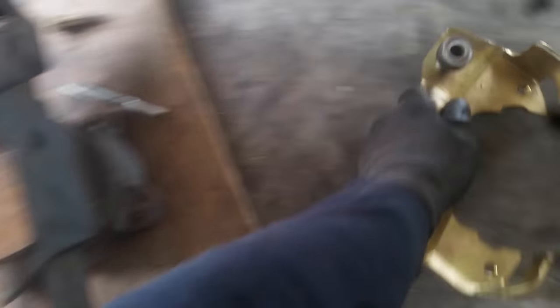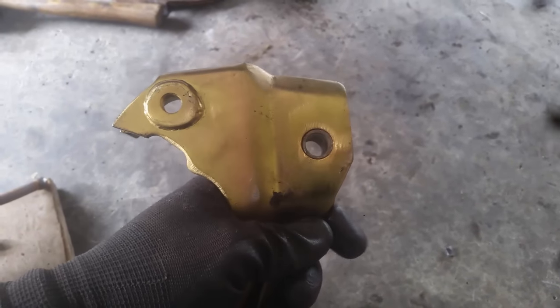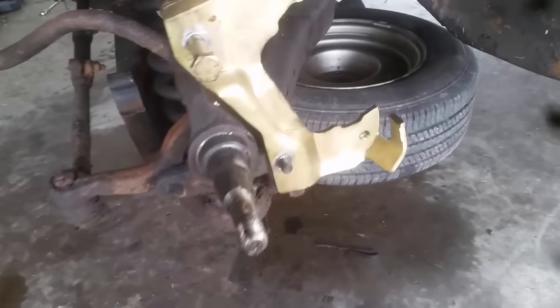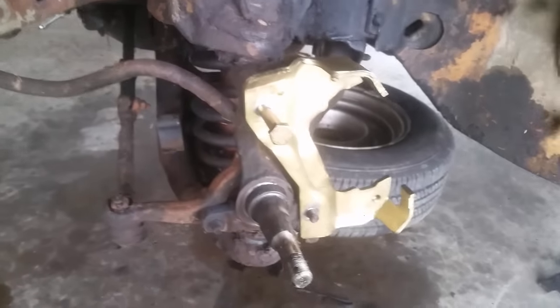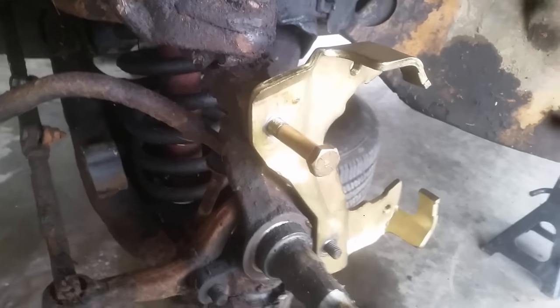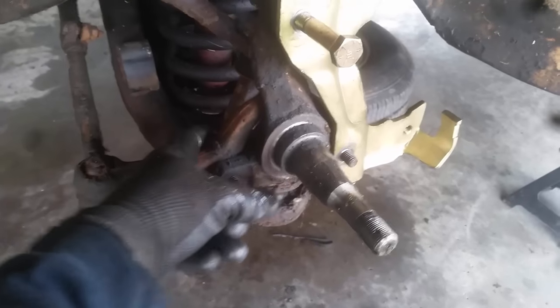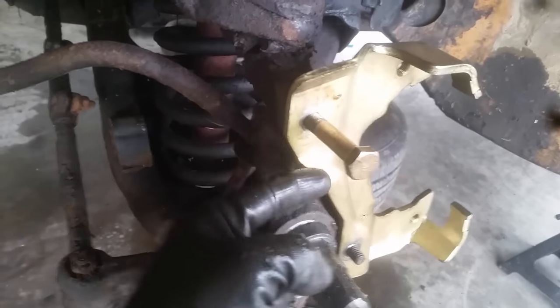It kind of goes in snug and you just beat it in. The tiny margin of error it has is insignificant — the key is to keep movement from happening. Then you just simply cut that off and you'll have it sleeved. At this point you'll have the 7/16ths bolt on, or if it's a Chevelle your half-inch bolt will already be in place. You'll just use the 5/8ths bolt and put the dust shield on. But with a Buick, Oldsmobile, or Pontiac — and of course different years have different-sized bolts — you'll screw in the half-inch grade 8 bolt provided for these lowers, because they provide you with two bolts for each side so you have four of these. You'll screw it into the top — it's half-inch dash 20 — and then slice it off, creating a stud.